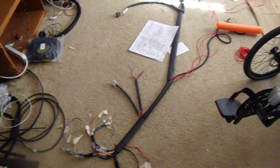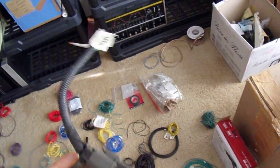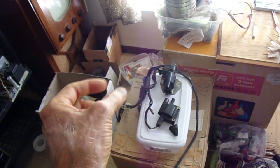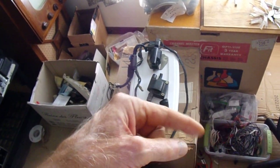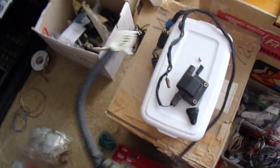Anyway, here's some of the stuff I've already gone through — as you can see I've got a whole variety of wires and whatnot. This is the distributor and ignition I plan on using — it came out of what I think was a '92 Pathfinder. It'll get its hot lead from one of two places: I can either run the hot lead off the harness, or run a lead directly to the hot lead that's in the existing S30. I kind of like the idea of having fewer wires to hook up outside of the harness.